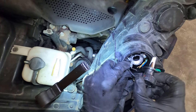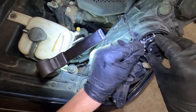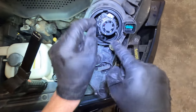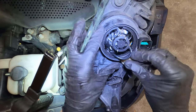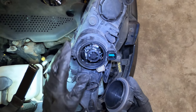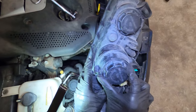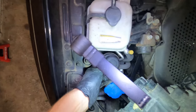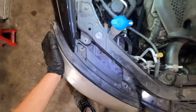We're going to move this in here. You see this other prong right here? What we're going to do is pull the bulb in and out so we can get it up and around so it's fully secure on the base. Seat the LED properly and then do the exact opposite. We'll tuck that in the rest of the way. Make sure your bulb is seated nicely and get the cap put back on. Before we go any further — just so you don't put in all that effort and realize it doesn't work — we're going to reconnect the bulb and turn on the headlights.